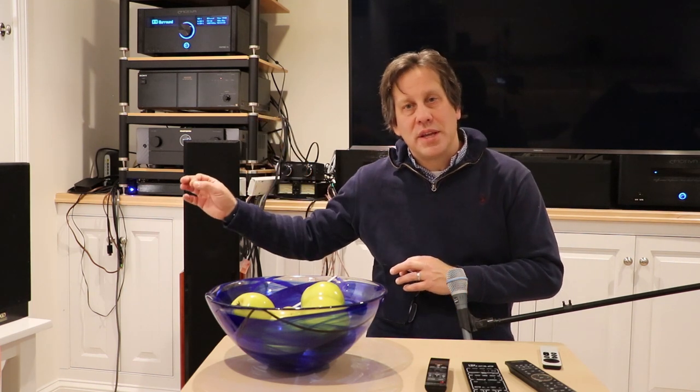In my case, going from the Marantz to the Emotiva, we had to make sure Zone 2 was turned on and that we were doing pass-through to the Emotiva. If you're doing something through your TV, make sure you're not using PCM — you want the bitstream pass-through. Setting things to PCM means you only get two-channel audio, not multi-channel. Also make sure on the Marantz that your surround mode is set to Dolby Digital rather than stereo output, and then you're getting those height channels as they should be.